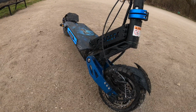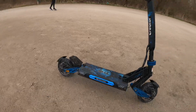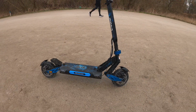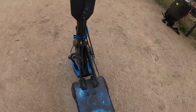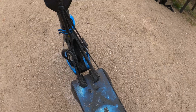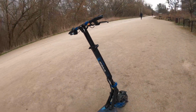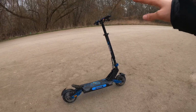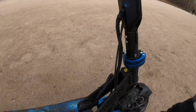At certain speeds, and if you brake hard and you have your balance in the back, then you can lose grip with the front tire. So you have to sort of lean forwards when you brake with the front brake, but then you have to put the foot here, so you put it on a charge board, which sucks. And you obviously don't want to apply pressure on the handlebar, since it's really, really tall, and this applies a lot of forces here on the folding mechanism in this.